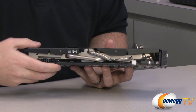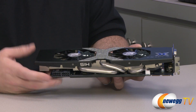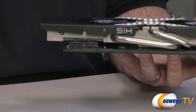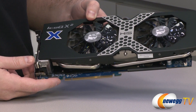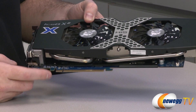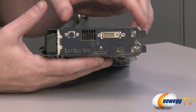That bracket extends all the way from the PCI connection point across the bottom of the card, providing extra support and heat dissipation. Down here we have the power connectors — two 8-pin PCI Express power connectors are required, so make sure your power supply has enough juice. This is a PCI Express Gen 3 card, so if you're on a newer system you can connect to Gen 3, which effectively doubles bandwidth by improving bus efficiency. That said, you won't saturate even a PCI Express Gen 2 bus with current-generation cards, so there's only a few percentage points difference if you're on an older system.